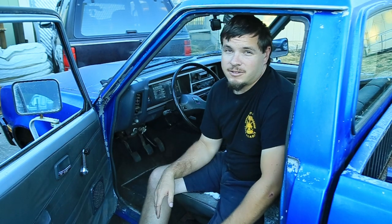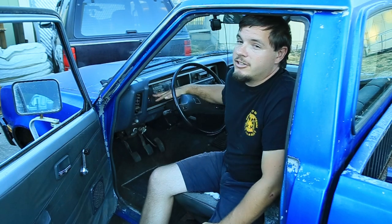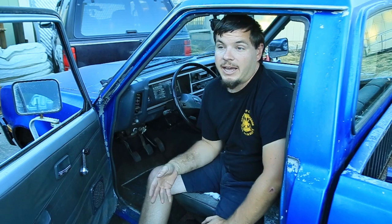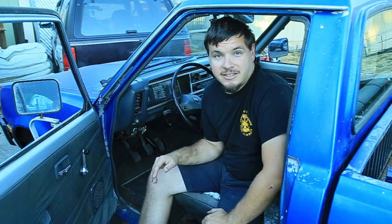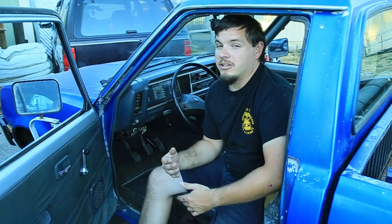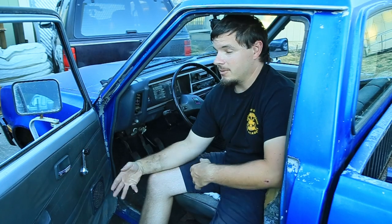Underneath the hood, there were some wires that had been chewed on. Maybe that's the whole thing. A lot of the cluster and some of the other gauges run off of a common ground. I haven't found it yet, but there's a common ground that they all go to, so maybe that ground's simply bad, or it's just simply non-existent. But that's gonna be in the next video that would be coming up. We're gonna just start diving into all the electrical issues. The speakers basically don't work. They're completely fried.